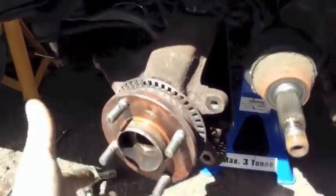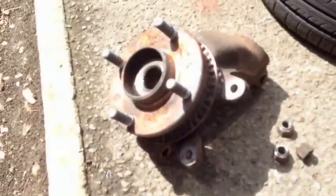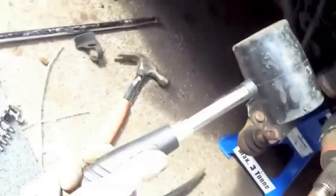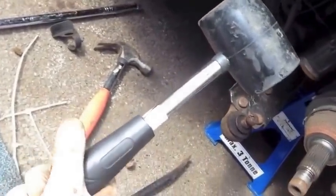There's the drive shaft out, just supported on the axle stand back there, and we're now ready to start tapping the hub off from up here. And there we go — one knuckle and hub. What I actually did was end up just tapping it with my rubber hammer, avoiding damaging the knuckle, and it came off fine.